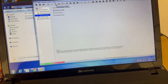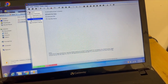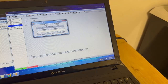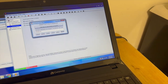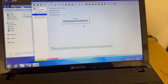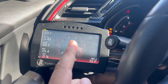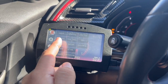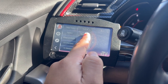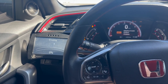And it's connected. So right here, upload base code, warning, make sure this is all going good, and we're gonna put it in 5, but we're gonna put it in 2 on number 5. And once that's done, it's gonna be in the Flash Pro, and we start data logging. All right, so then from here, Ktuner, Flash, revision 2. Only because I didn't really film the first revision and it was dark too, so it would have been a pretty bad video.